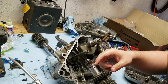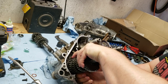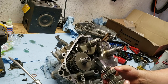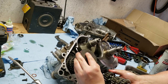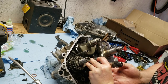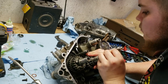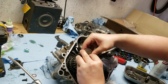Next is the drive shaft — I've already got the new O-ring on there and I've already oiled up this and the bearing, so I'm going to go ahead and just push this in. It will also mate with the counter axle. And lastly is the main axle. Whenever you're putting this in, I find it easier to take off this last gear and the washer first so you can stick this down in here without that gear being in the way. And just like that the main axle is in — I'm going to go ahead and put this gear back in and the washer on it as well.